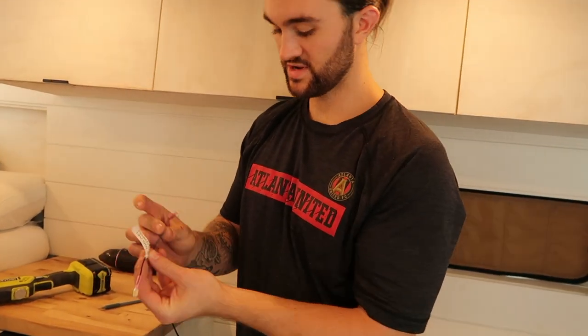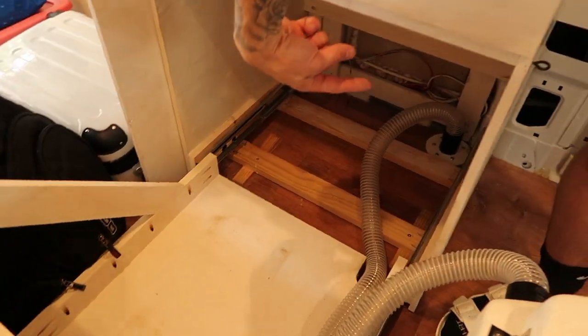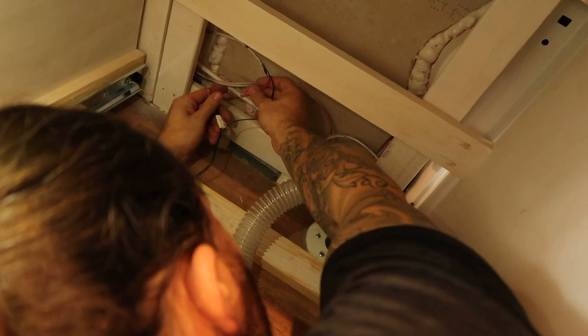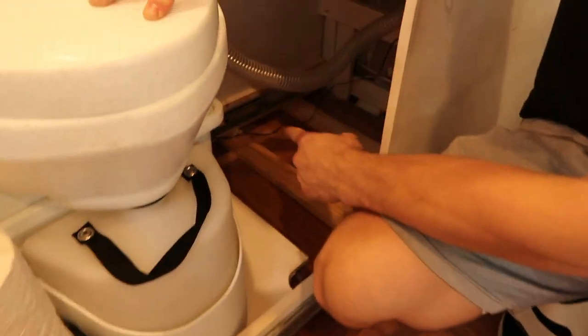So I have my spade connectors — positive, negative — and you can also see that I have my vent tube connected to the toilet and to the exhaust back there. So now all I have to do is set this in here and hook the spade connectors up. So more good news, bad news. Good news — we got everything situated. We got the wire and the tubing in a spot and zip tied up over here in a spot where, when it closes, it doesn't get pinched or bogged down or stop the toilet from sliding all the way in. It's good to go. But bad news — the fan that comes in the Nature's Head toilet doesn't work. Our fuse block in the back actually lets you know if there's a current running. When we take the fuse out that shows there's a current running, we throw the fuse in and it still isn't working. So we're going to have to contact Nature's Head, hopefully get it replaced. We will check back with you when we receive it, install it, and hopefully it's operational.